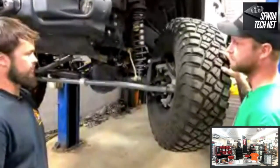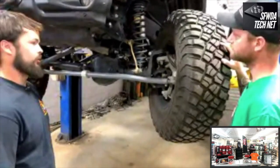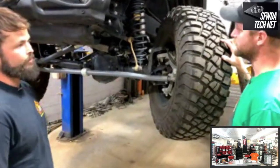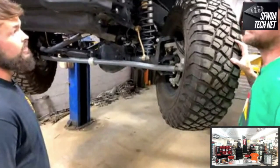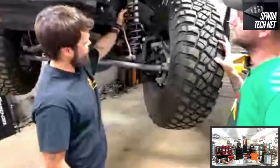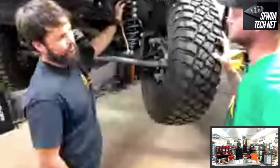For slow trail crawling, basic bump stops are perfectly fine — as long as you have good up-travel from ride height. Where a lot of people go wrong is ending up with only about one inch of up-travel just sitting there without even going off-road, which is very abusive to the bump stops. On older vehicles, the foam bump stops can actually break and crumble into pieces. You can replace them with factory-style foam or polyurethane, which holds up longer but is a bit harder than the factory foam and does slightly better in mud.